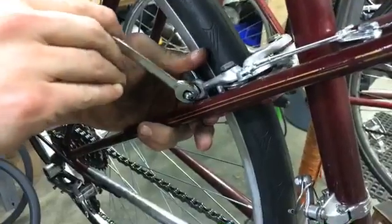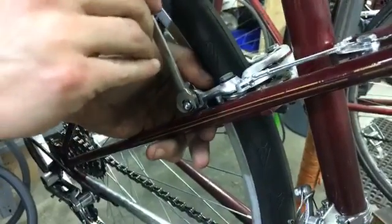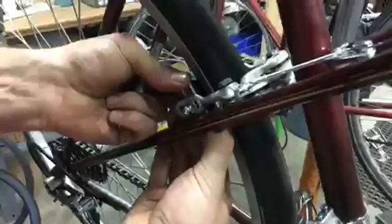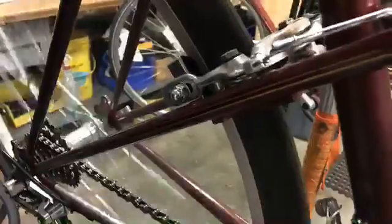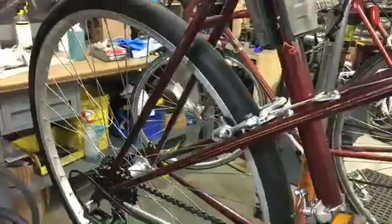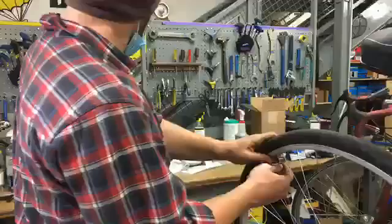So tighten it, and then I'm kind of just putting a little force to prevent it. I'm rotating in one direction. I don't want it to rotate, so I'm just holding it. And then, maybe just rotate that down a bit. So we've swapped out a brake pad. So, you do that for all 4 of your brake pads, and it is something that anyone is capable of doing. So that, I think, is almost all I wanted to say about brakes.